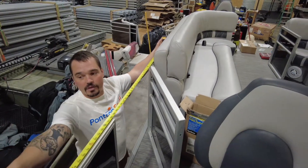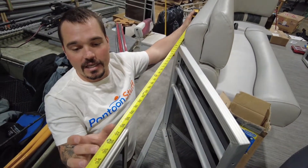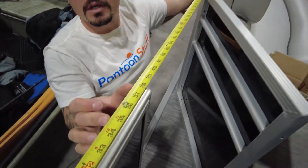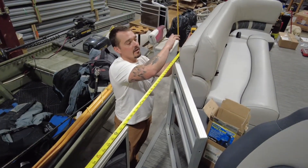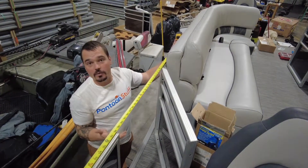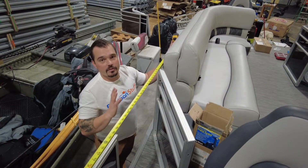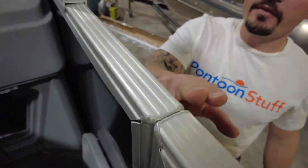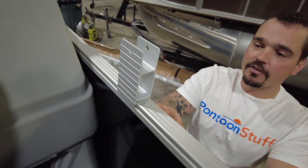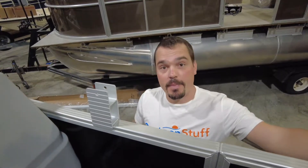From the rear, I need 36 inches from the end of the bracket back, so the bracket here is actually going to go very close to the door. Then we can measure our 36 inches back, and our 38 inches forward is going to clear this doorway by quite a bit — so we have plenty of room. Using the seams and measuring on each side, we've determined we're going to be 10.5 inches forward of this seam for our center bracket — leaving 36 inches back and plenty of space to go 38 inches forward.